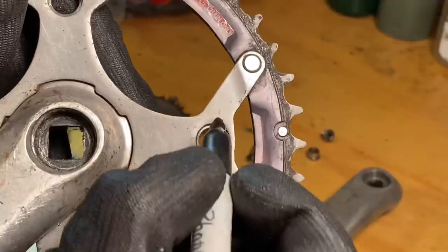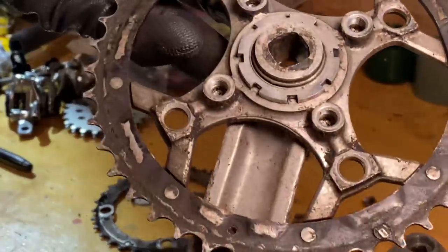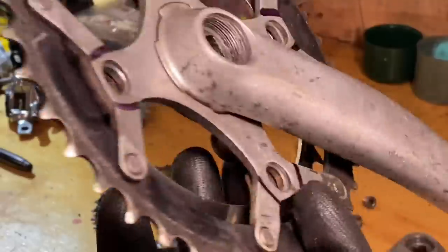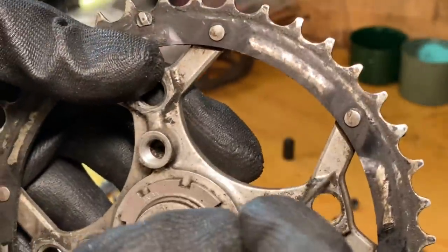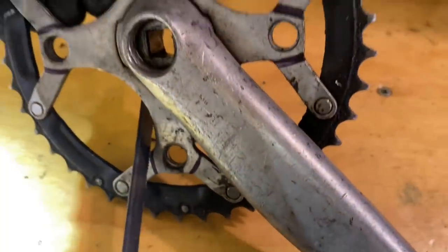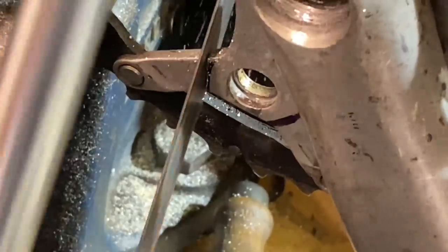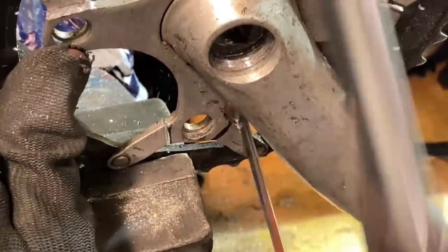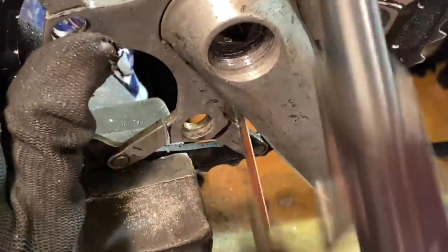When using a single front chainring setup, you could trim that outer chainring down, but I decided to get rid of it altogether. You could keep it or shave it down to act as a bash guard, but I wanted to cut it off. Going along these lines, it leaves the 104 BCD holes and the little ledges that support the chainring, so you can get your hacksaw in there. One of the cuts was a little bit hard to do near the crank arm, but it was still possible — just a little more fiddly. I used a lot less stroke in my cuts and then used two cuts to get it finalized.